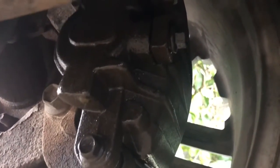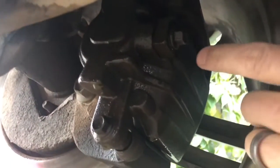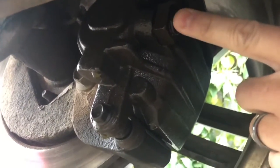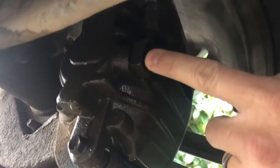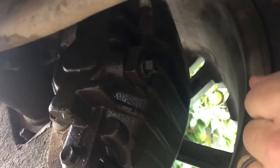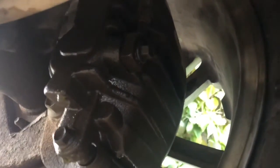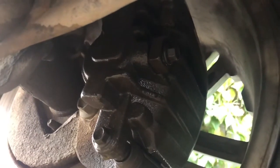So I just got some new crush washers in hopes to fix it with just that, because it's only $3.90 for that. Alright, and then worst case scenario, if those washers do not work, then I'll just buy a new brake line. A new brake line's like 25 bucks. And I'll go that route. So what I'll do is start disconnecting it and get going.